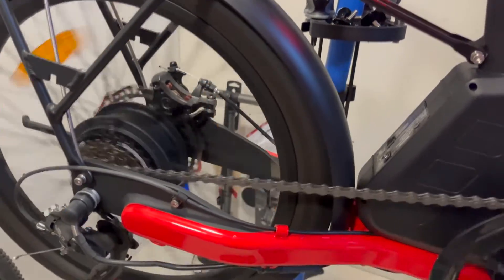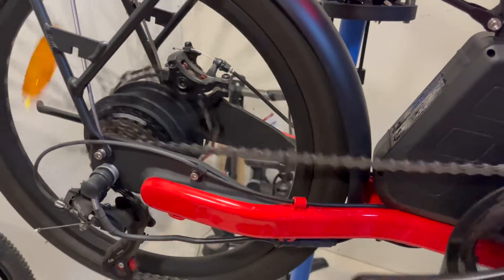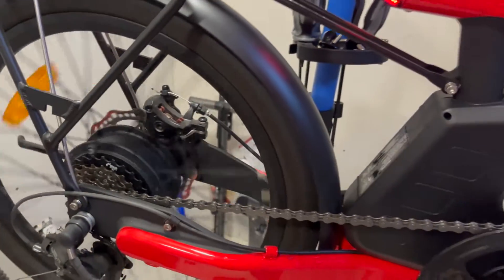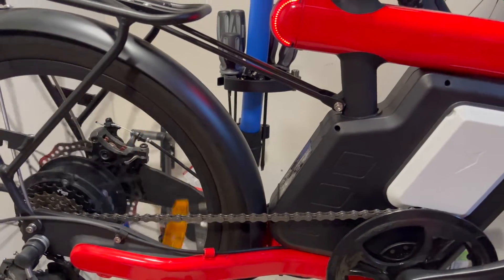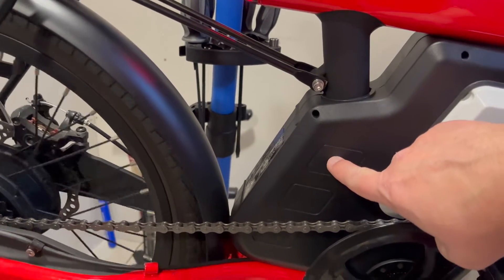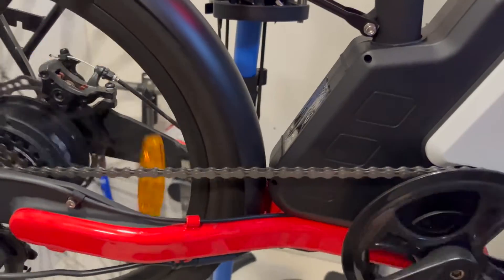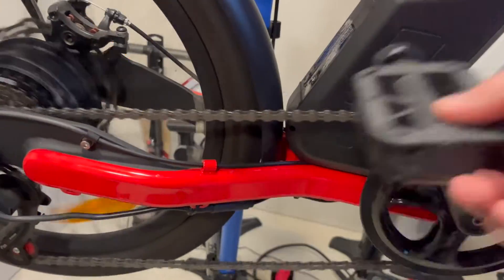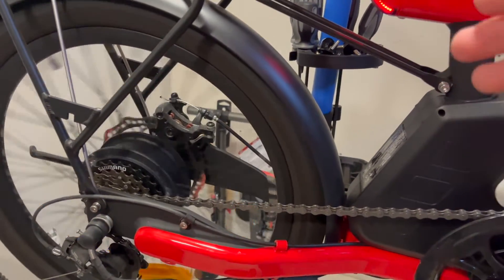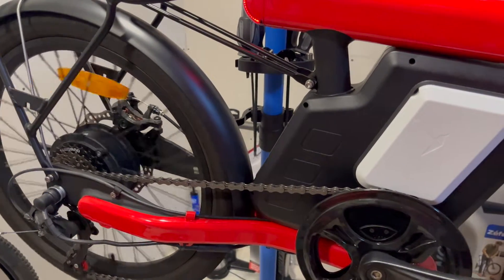So you can see where that could create potential issues. The question is, how do you stop that? This bike's pretty good, actually really good, but even on this one every now and then, if it has a cadence sensor and a rear hub motor, you're just going to have that prolonged boost. I think there is an explanation — it's the programming of the speed controller, maybe a little anticipation programmed in there, so that if cadence is slowed or stopped, it assumes it should keep on a little longer before it tapers off, just to keep the ride smoother. But that can create issues and problems.